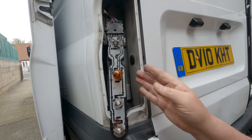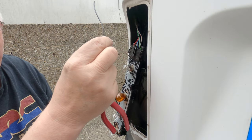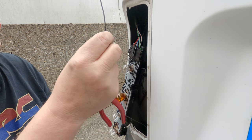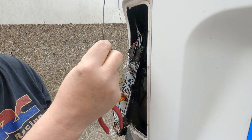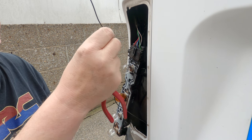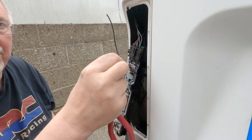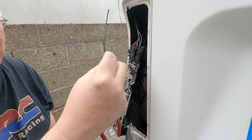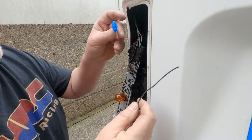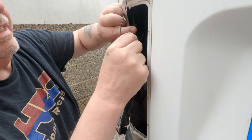I get wire by buying seven-core, which is for trailer hookups and such like. You can buy it by the meter and then you get seven different colors — it's a nice easy way of getting a variety of colors in reasonable lengths if you're doing some wiring on your car. I'll put that in the description. What I'm going to use is a scotch lock.